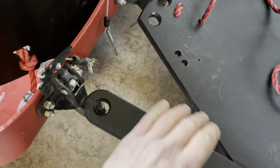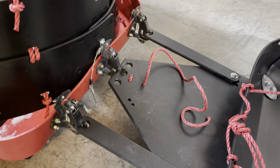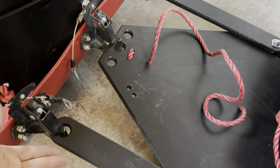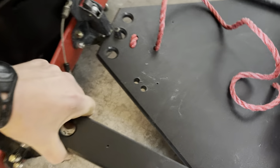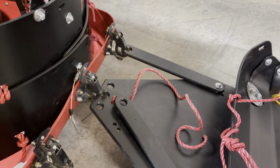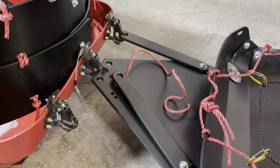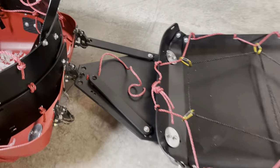Sorry, that's a little harder to do with one hand. Lock it in place — so when you're traveling fast and you don't want your toboggan to flip over, and you don't want the tail-wag-the-dog, you hook those in place. When you're navigating a tight, twisty trail, you unlock, pull up, rotate to the middle, and run the ropes in there. This system we've proven hauling four sleighs full of drums of fuel at a time at 50 kilometers an hour, and it works pretty amazing.